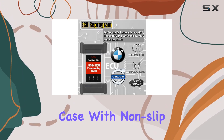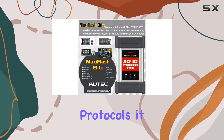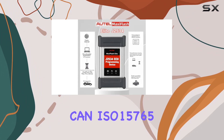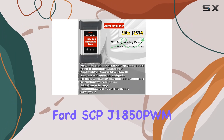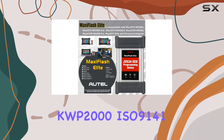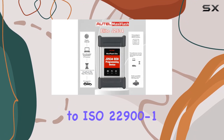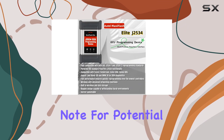The rugged aluminum case with non-slip rubber end caps speaks to its durability in harsh environments. In terms of bus protocols, it covers primary CAN ISO 15765 GMLAN, secondary CAN ISO 15765 GMLAN dual or single wire, Ford SCP J1850 PWM, GM Class 2 J1850 VPW, KWP 2000, ISO 9141/14230, and Chrysler SCI J2610, compliant to ISO 22900-1 MVCI physical layer.